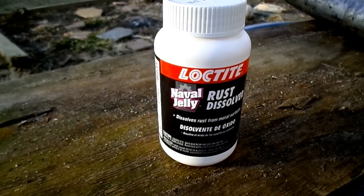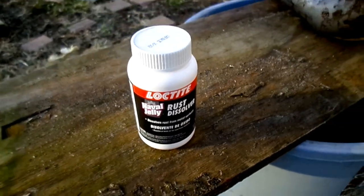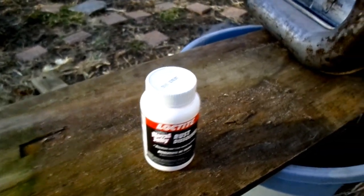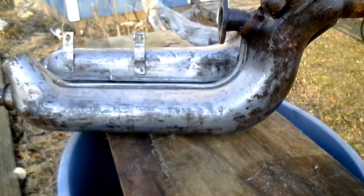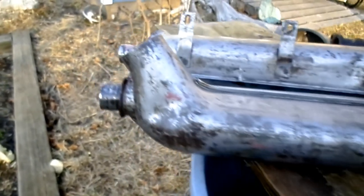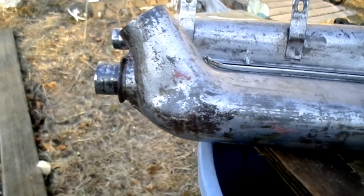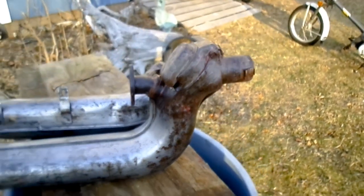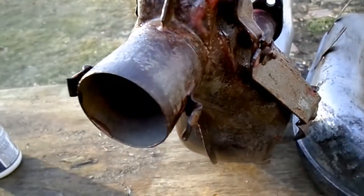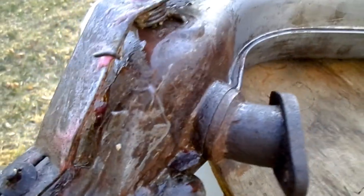All right, so this is the next step. I ended up getting some of this rust treatment, because I don't have a sandblaster. After cleaning all the oil off and wiping them down with engine degreaser, they came out pretty good. The top is a little rusty and I want to stop that rust before I paint it. Without a sandblaster, I just want to stop that rust — brush this stuff on, it kills the rust, then I'm going to paint it with a high-temperature primer.